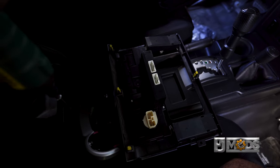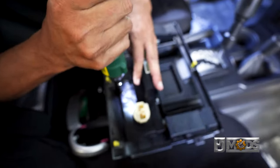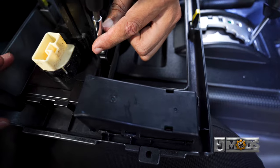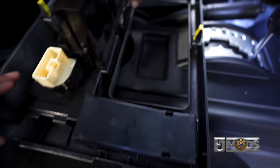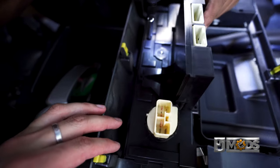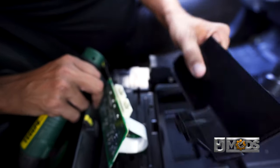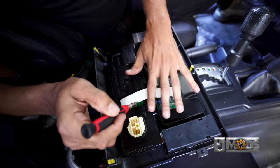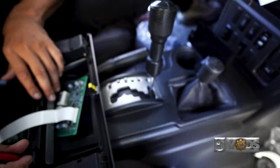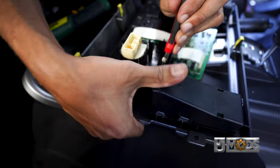This has about four screws that we're going to take out — four screws and a strip. We're going to keep these on the side because these screws are actually different from the side screws. The last one is right in here, and now we should be able to pull this right out. Now that we have this part out, I'm going to carefully use a screwdriver to pull this up here while applying some pressure so we can start pushing it out.